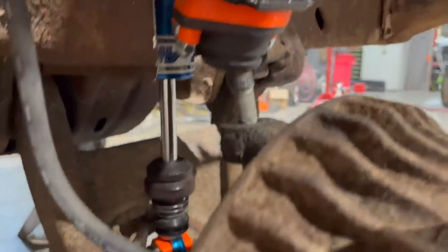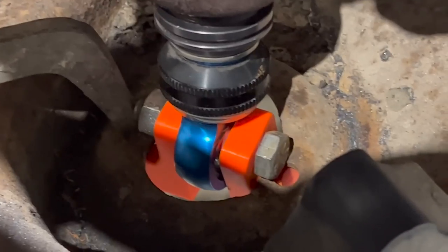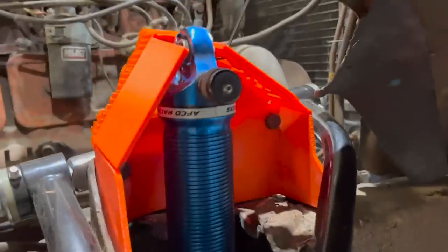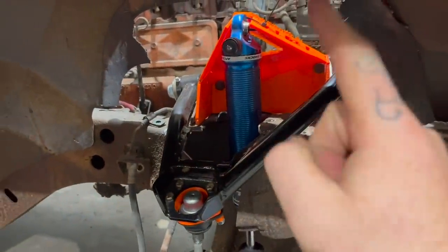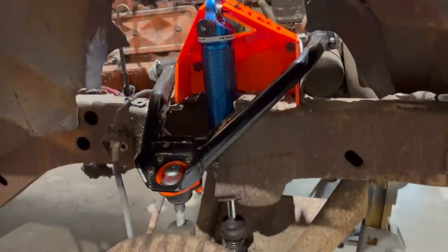But this shock is actually going to be way too long, because as you can see, this is full travel and we've only got half the shaft showing. I ended up bolting that on my shock and then clamping it down to where it's setting right where it would mount if it had a T-bar in it. And then that gives me my measurement for what I need shock-wise. So I'm going to go change my design just a smidgen and get a new bracket printing, so that way tomorrow I can actually mount this shock and everything on there.